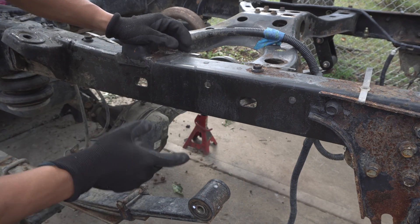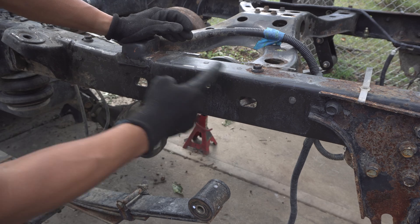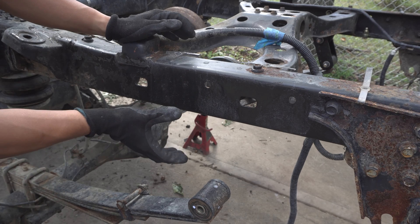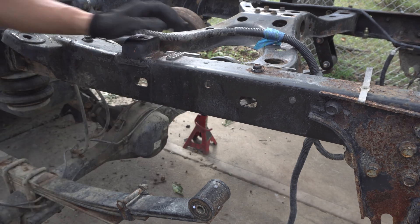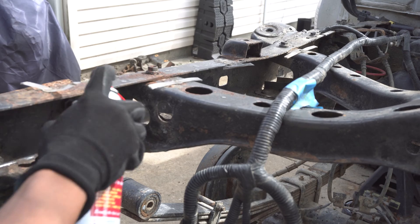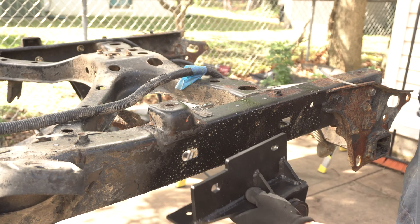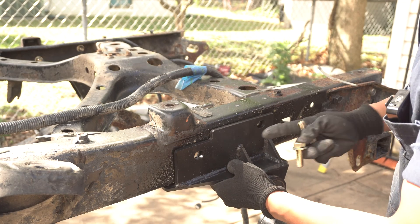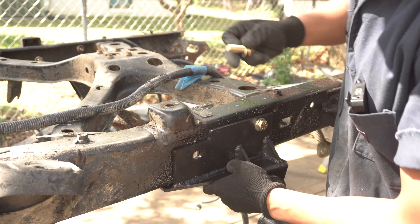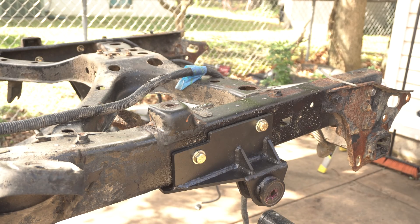Here we are at the driver's side frame. In order to keep the corrosion down, I'm going to spray this whole area with fluid film, as well as the surrounding areas. This is good practice because we are sandwiching the bracket up against this frame. Now we can put in the bolts. This is positioned so that it's forward to the backside of this frame — position it just like that. We'll put this other bolt in here; it should just float without the other hardware in the meantime.